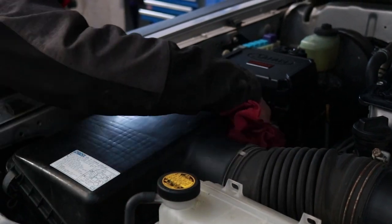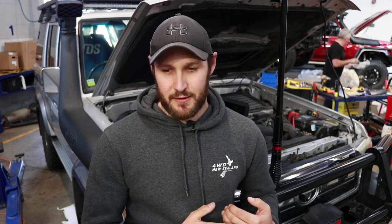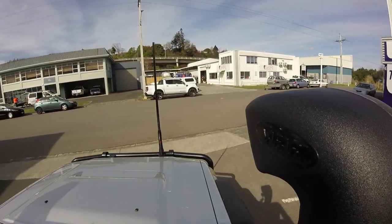Now that the RMAX package has been installed - we've got the ECU in, the exhaust bolted up, clutch in, and the snorkel in. We're waiting for a phone call from Melbourne and they're going to remote log into the car and install the tune. Once we've done that, we're going to take the car for a drive, come back to the workshop, plug in the laptop again, and send the data log to Melbourne. Melbourne's going to analyse it to make sure the car's running right and the tune's been installed correctly. I've literally just loaded the tune up and this is our first road test.